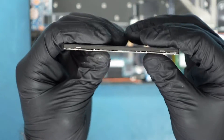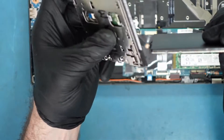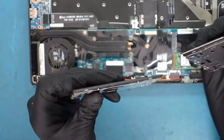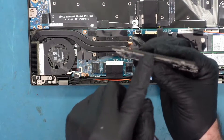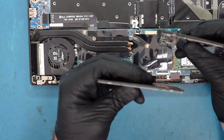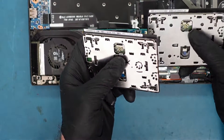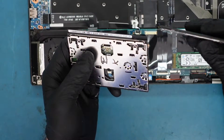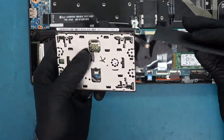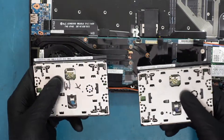See this? This is the mechanism here — this is a post-a clamp. Here's a replacement. See the difference? Hear that click? And this one doesn't go. There's a little piece of spring here, a metal piece — it's broken. Maybe we could fix it, maybe there's a way to lift it. If you can't find the part, possibly do that; otherwise just get another one. These trackpads have a board underneath and also a spring and other components. There's most likely an Elan driver that goes with the touchpad. Anyway, we're just going to swap it out with the good one.